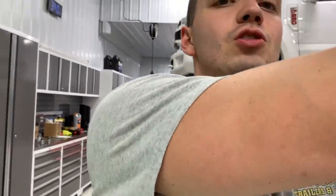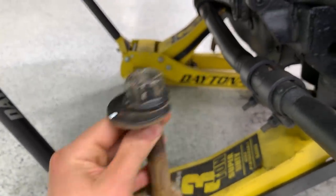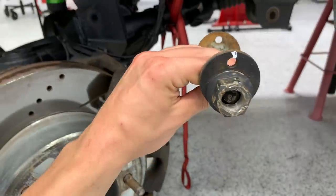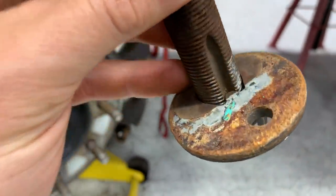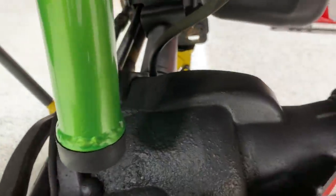We are back on day two of the install. Yesterday got a little late, but we got the four-link bars off the truck — that was a big win. An even bigger win is that we were actually able to save the lower cam bolts. These do not come in any lift kit; they're OEM parts that usually get stuck and galled into the bar. These are responsible for adjusting the pinion angle — the angle at which the axle sits — so you can't just throw a regular bolt in there. They fought us, but they came out, and we're super happy about that.